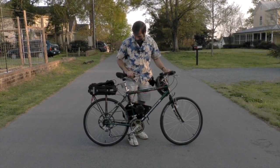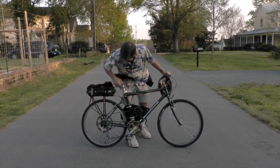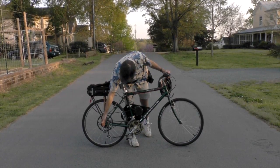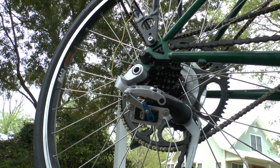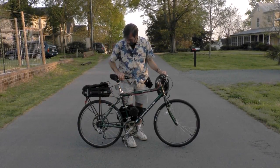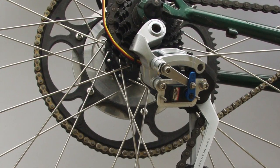What I'm going to show you today is an electronic shifter. What I've done here is taken an ordinary derailleur and put a radio-controlled servo inside it, so there are no cables anymore attaching to the derailleur. Instead, the shifting is done by this set of wires.